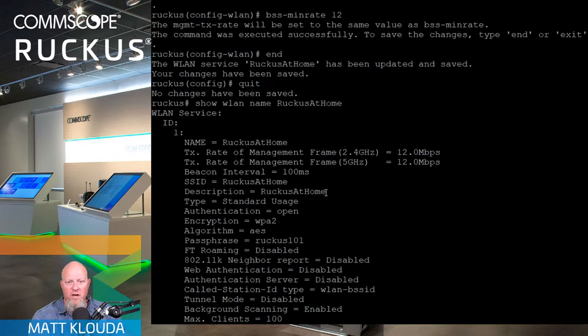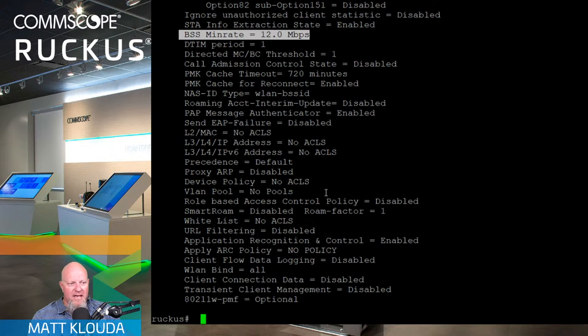So OFDM mode is running or not running. It's usually set to 5.5 by default, which means you can have a device that's far enough away with a weak enough signal that it'll stay on that access point. And you know, I mean, clients, once they attach to an access point, they just kind of stay there. They don't really let go of it. This will then force it to say, oh man, I got to find a new home, and they will. So when you do this, you'll see immediate changes right away, okay? These are steps that are used by our support staff.